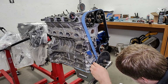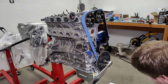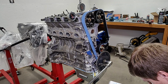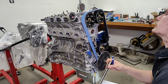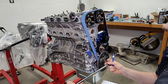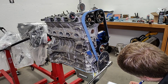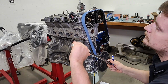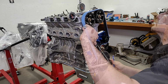Right, okay. So 50 degrees. Now we're at 61.5, 66.5. That's exhaust open. So that was you just looking for when the exhaust started to open? Correct. Intake open should be my next event. 50 thousandths intake open. The next event should be exhaust closed. Puts me at 25. And intake closed.